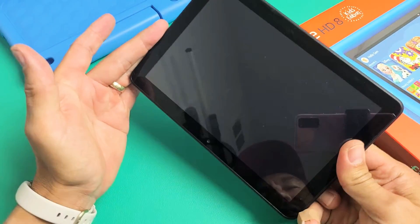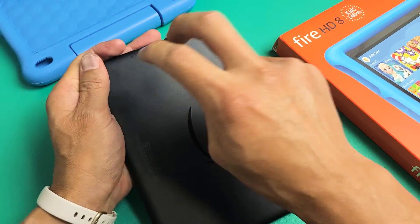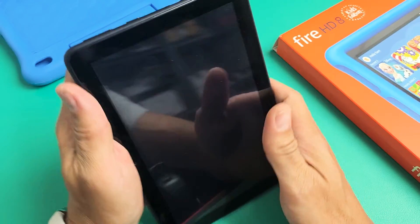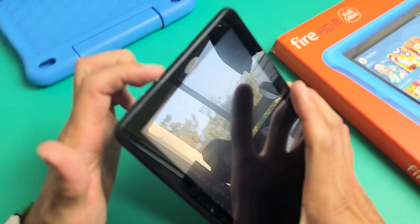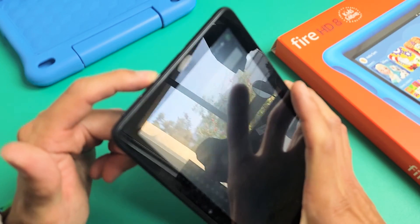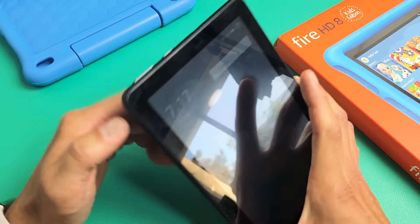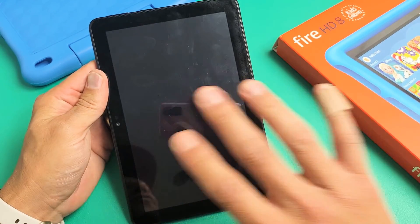Sometimes keep an eye on the screen as you tap — maybe it turned on, or you might see half the screen or white lines or a flash. Now the same thing on the back — all over, give it some nice taps. If it's still black, no problem. From here, go ahead and force restart it again. Press and hold the power button for 15 seconds until it turns totally off, then let go, and press and hold again to turn it back on. Hopefully you're back up and running. If not, we're going to go to the fourth solution.